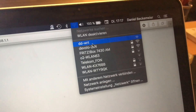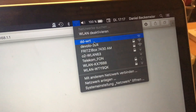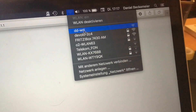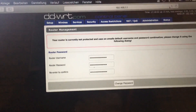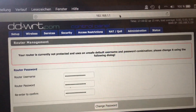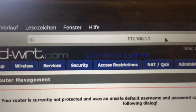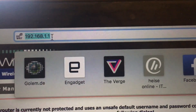After that long break you can switch back to wireless configuration. Use your notebook or MacBook and you should see a new wireless network called DD-WRT. Connect to that network — it is unsecured and requires no username or password. After connecting, you can access the router with the new DD-WRT firmware on its standard IP address, which is 192.168.1.1.